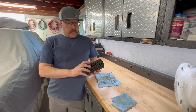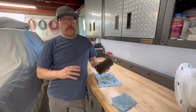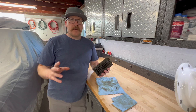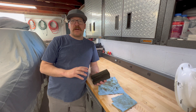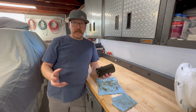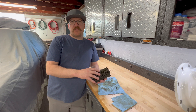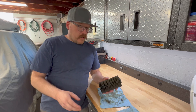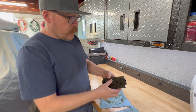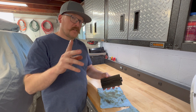Fortunately for me on this oil filter, I don't have to worry about removing the metal canister. On this application, it's just the paper element that goes into the insert, but on cases where you do have the metal canister, you can go ahead and cut those off. They make tools to cut those off — you can use a pair of tin snips. I shy away from using anything abrasive because I don't want to create any sparks or small metal to give us a false reading while we're looking at the filter. We all know you cut the filters open, move the pleats, and take a peek and look for metal, but there's one more step that's going to give you a much better idea, and that's what we're here to talk about.